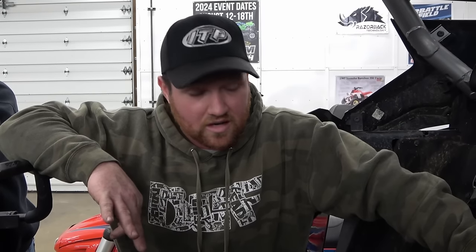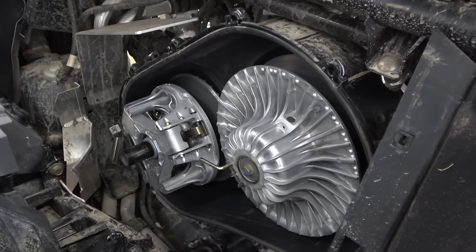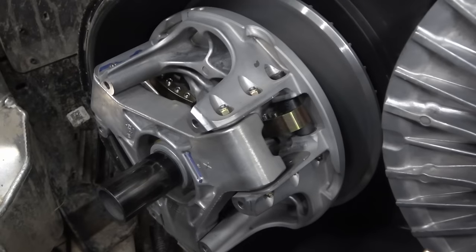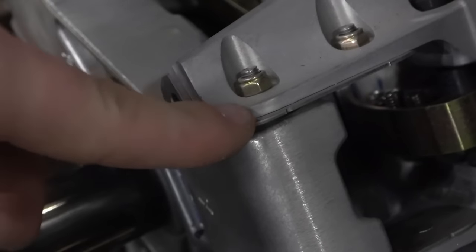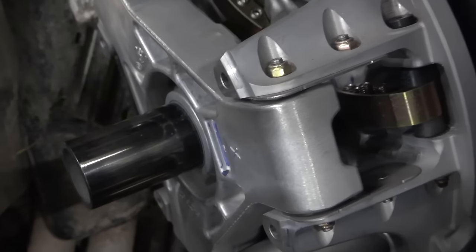We're not taking mine off, so let's start putting this back together. The last thing we're gonna do real quick is blow everything out really good with air, then wipe down the sheaves with some acetone and we'll be good to go. Blowing out your clutches is a very good idea for periodic maintenance — I know these are kind of a pain to get to compared to other machines, but it'll still very much prolong the life of your clutches. Also if you blow a belt, really pay attention to these wear plates right here, because belt chunks can catch on that little bit that sticks out and bend these wear plates. Once they're bent, that spider will bind up in there and you'll have some pretty serious shifting issues. Luckily they're replaceable.